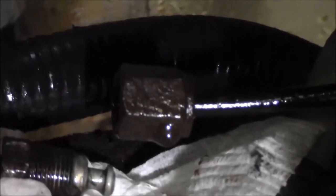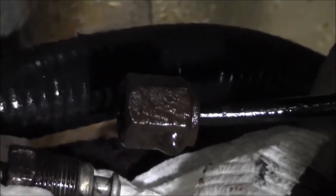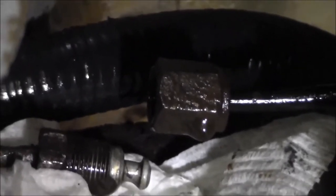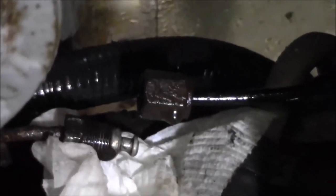So that is right here is the 15 mil, and then that side of the brake line was a half inch. This probably would have gone a little bit better. I probably should have scuffed down that 15 millimeter union, because there's just enough rust on there to make it really hard to get the 15 millimeter wrench on there. Quite honestly, I'm not 100% sure that's even a 15 mil, just based on the corrosion on there, but the 15